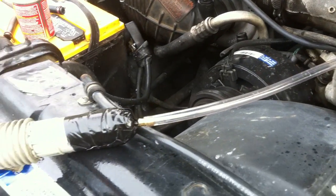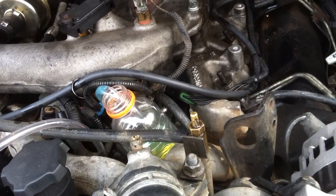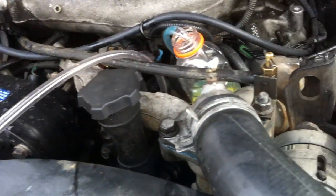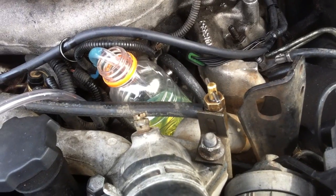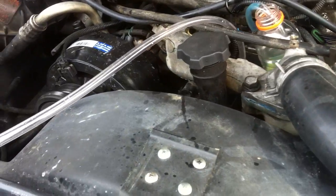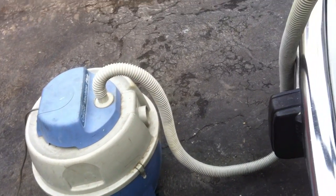I should get rid of my air bubbles at the T-valve right here. I have to vent this thing probably every — I don't know — could be 20 miles, 50 miles, 60 miles. But I have to do it fairly regularly. I've eliminated a lot of the other potential air leak issues. I had a couple with the valve itself — I went and repacked it, put a gasket and an O-ring on it. There was fuel actually getting by there, so there was a leak. I blocked that off and I'm still getting this issue, which could be from restriction in the return line. So hopefully this should do the trick.